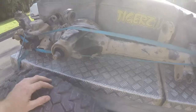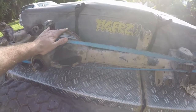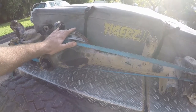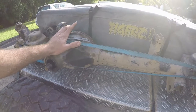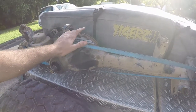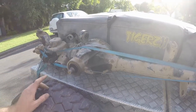I'm going to talk about my experience with the Dana 30. I've found there are three major shortcomings with this axle. The first major shortcoming is the size of the ring and pinion set — they're not up to the types of loads that I put on it. This is the third time I've broken the ring and pinion set, so really not up to it in that capacity.